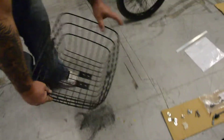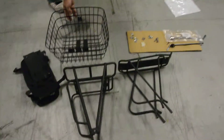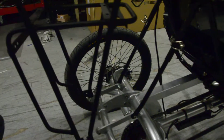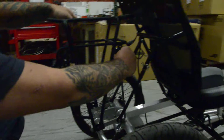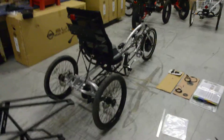For a less DIY solution, we've got the recumbent basket from JMB, which is good for the lighter 9 amp hour, 4.5 pound batteries. You can mount back there with the battery in its bag in the basket. Or you can also pick up our two-tiered rack or a regular rack like the Axiom Journey rack, and mount those to the seat ears on the back of the bike, pointing the rack struts way down and mounting them to the front of the ears. We don't do that a lot in the shop because the basket sticks out a bit and looks a little weird since the rack is meant for a regular bike. But it does work, you can mount a battery on top of it, and it's very easy to do with no custom hardware needed.